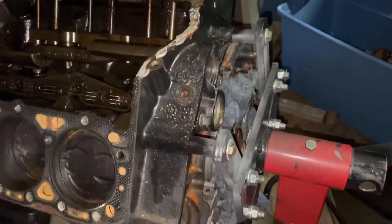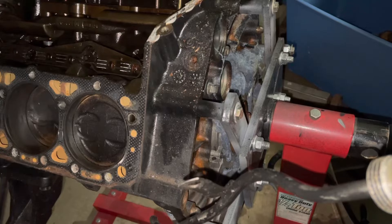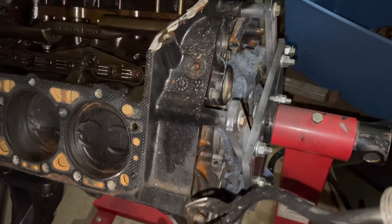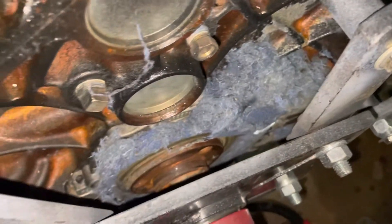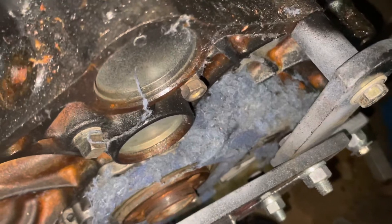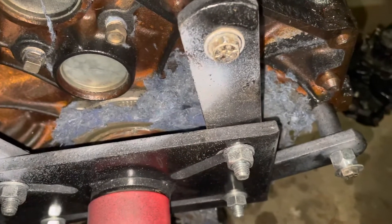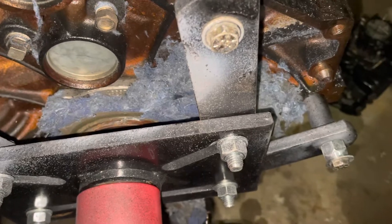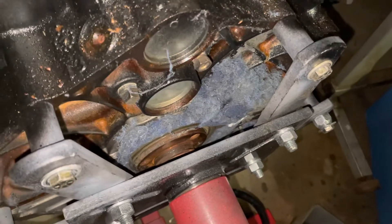Before I end this video, there's the mystery of the missing shop rag. The last mechanic that worked on this engine lost the shop rag. It looks like he left it in the bottom of the bilge, and the bilge filled up with water. The shop rag got sucked up beside the starter and got pulled up behind the flywheel — and there's the missing shop rag, all gooped up and ripped to shreds behind the flywheel. I've never come across this before, but that's just sloppy mechanic work. We found blue lint — almost like blue dry lint — all in the bilge of this boat, everywhere. It got shredded and floated free into the bilge. Just thought you'd like to see that. Thanks for watching.